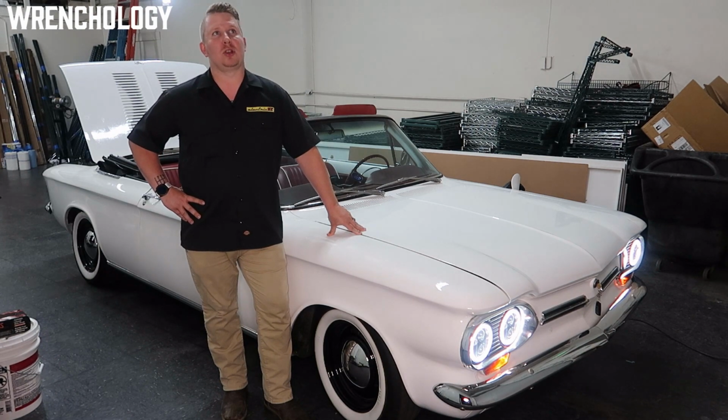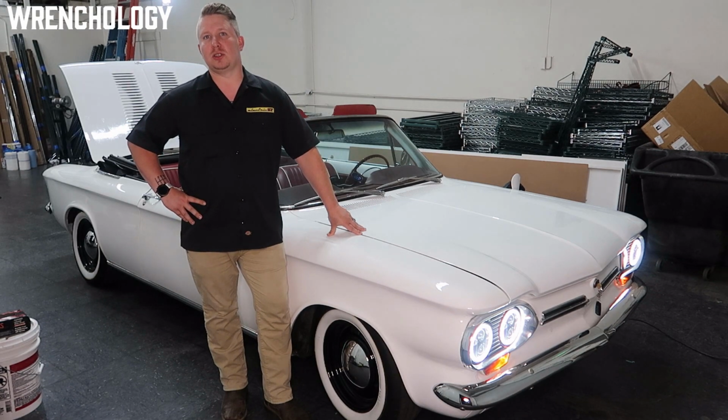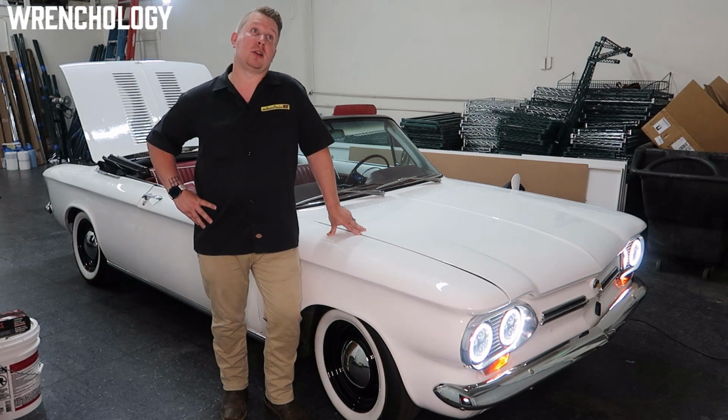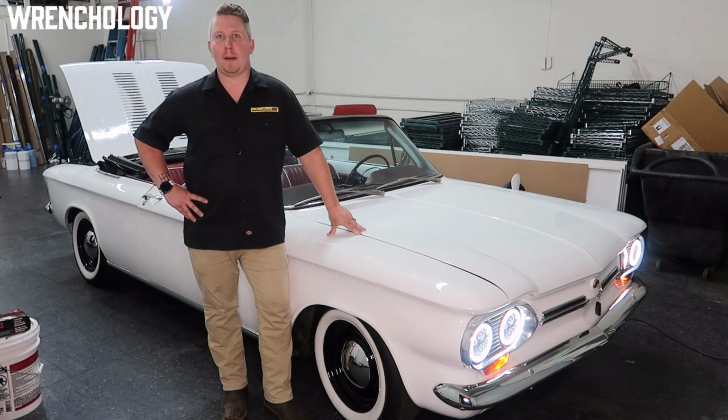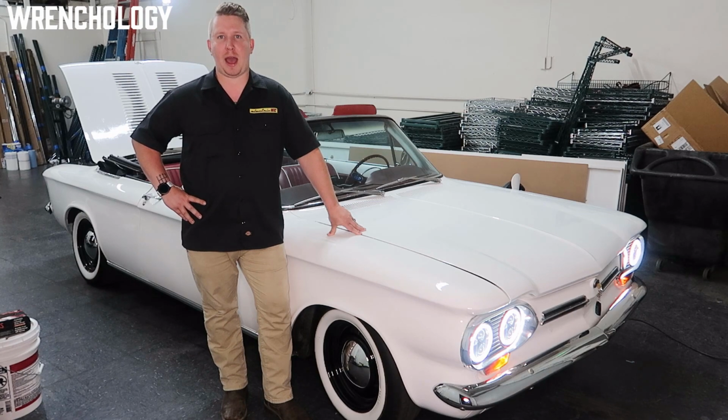I believe fully charged is about 124 volts, and discharged, I try to keep it above 100 volts, but if need be, I can drop it into the 90s if I'm in a crunch to get somewhere if we're getting closer to the bottom of our pack.